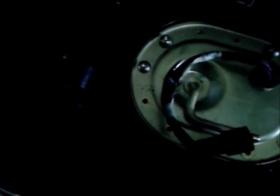So just reinstall all these little Allen bolts, making sure you've got them all in the gasket and not cross-threaded or anything. I just put them in loosely, and then we'll crisscross them. And I've just checked the book, and it's 9 Newton meters each bolt tightened. So there's not a lot of weight on them bad boys at all, so no need to overdo them.